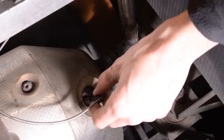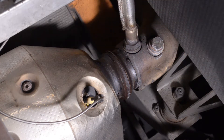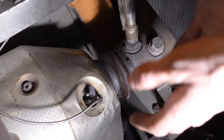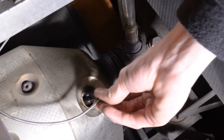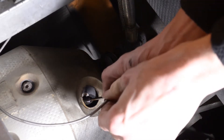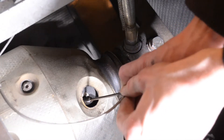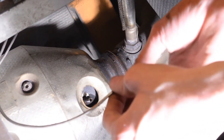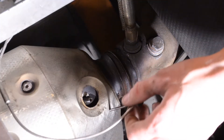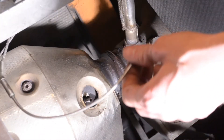If you're having a problem getting these EGTs out, I would say spray a little bit of PB Blaster into that little interface. It's a closed element sensor, so it's just encased in stainless steel, and that should loosen things up between the exhaust pipe bung and the actual temp sensor. I think it just gets a little bit rusted over time and the sensor is super long. I do not want to damage these — they're very expensive and proprietary to Lamborghini. So that's a little tip of mine.